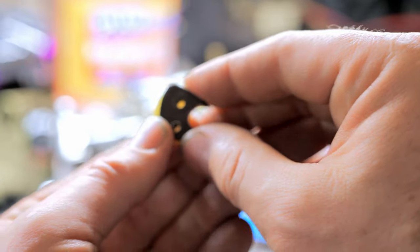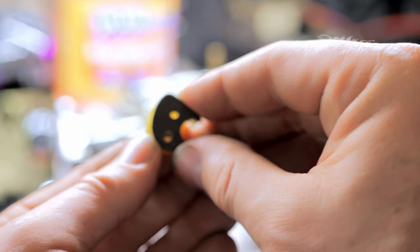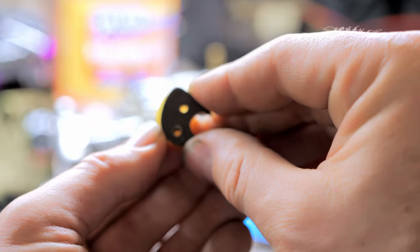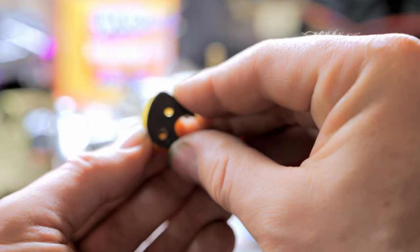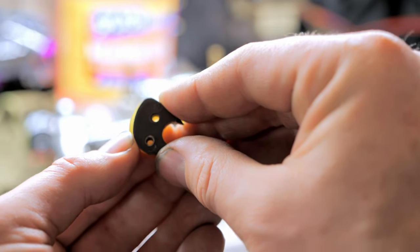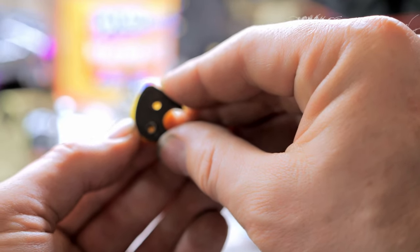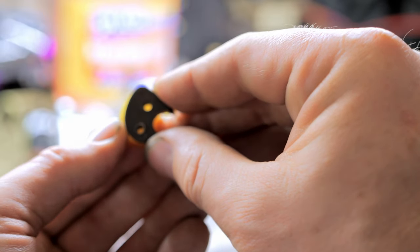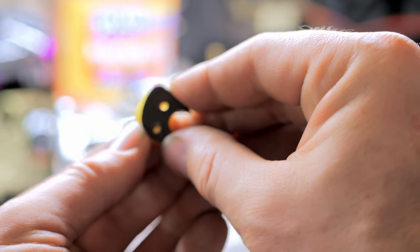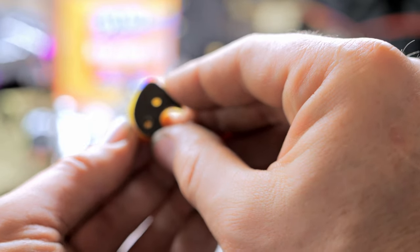So this, I can't give you any inclination of how you should set it up. You're just gonna have to use a wideband and watch it and try to get that target air fuel when you stab at it to not be super fat like nines or peg lean. You wanna get it in between. If you get it in between like 11.0 to like 12.8 range, if you hit like 12s or something when you stab at it and it goes right there to the happy land, you got something going on good. Because it's all depending on your application and your vehicle. You cannot just say do this or this cam and have that work.